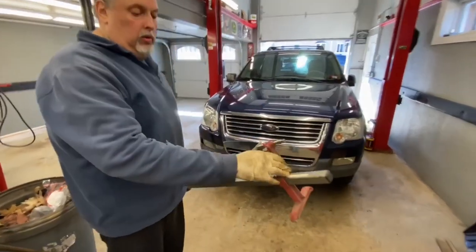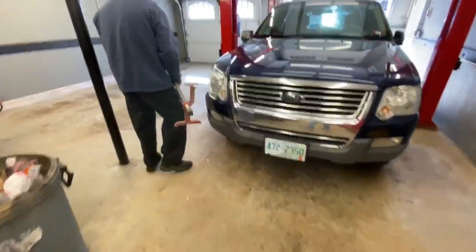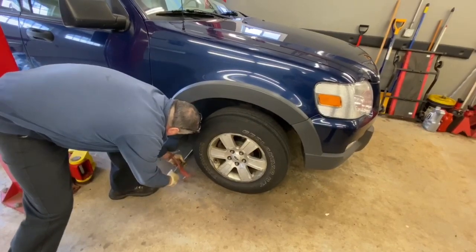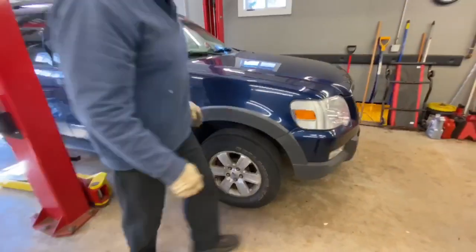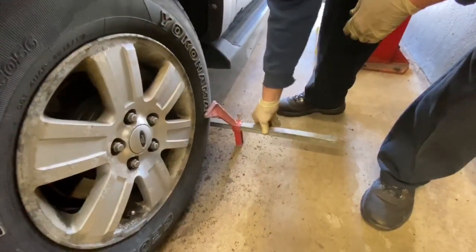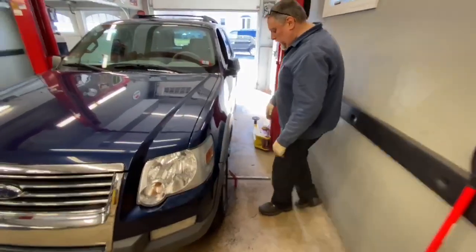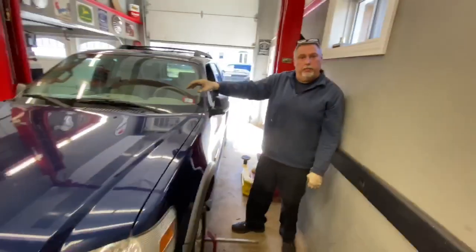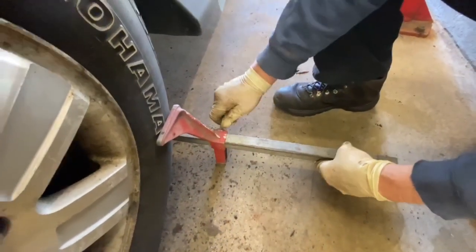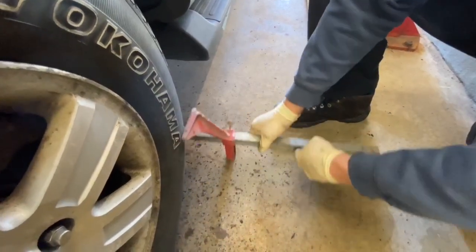So we centered the tool out at zero on the gauge here, and then we're going to slide this around to the back of the tire. You already start seeing your toe-in from the back wheels. Slide it underneath and get the slide over to the side. You have to make sure that this slide is on the wheel and it's not tight — just right there. This side is adjustable. When you center your bar over there on zero, you put your gauge on zero — that's your starting point. Then you have this jam nut where you can slide this out and in. Slide it up against the tire and tighten it, but make sure it's not too tight. Back it off a little bit so you can just slide this on.